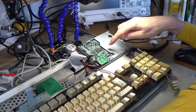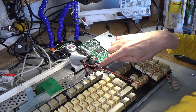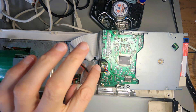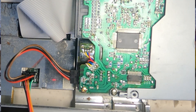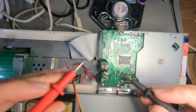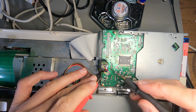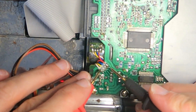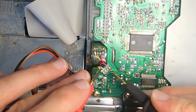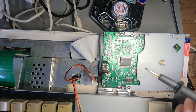So the drive is upside down and plugged in, and I've been trying to find out what's going on with it. I've measured the voltages coming in - the two center pins are ground, the red is 12V and the brown is 5V. I've measured those and they're all good. It's just this stepper motor - it just doesn't do anything. It's got these four wires and I believe two of these are connected together and two of the others are connected together, because it's like two coils that drive the motor. But the thing that is perplexing me is they all appear to be shorted together - every pin is connected to every other.